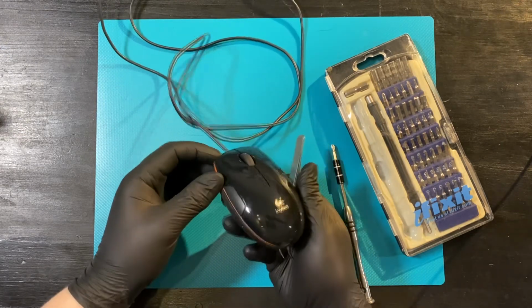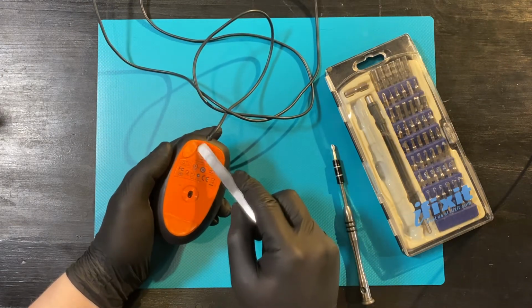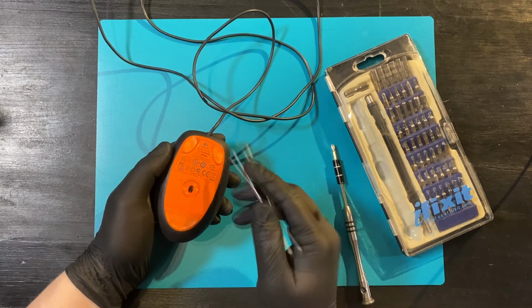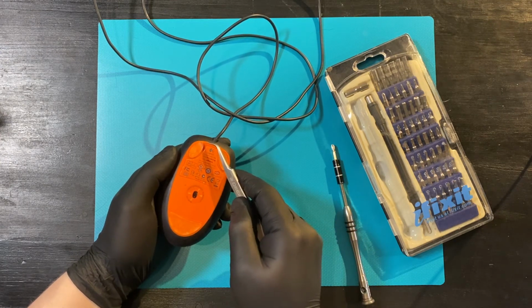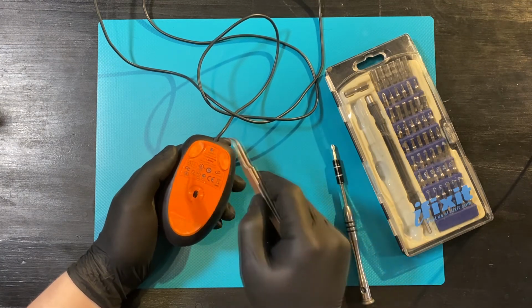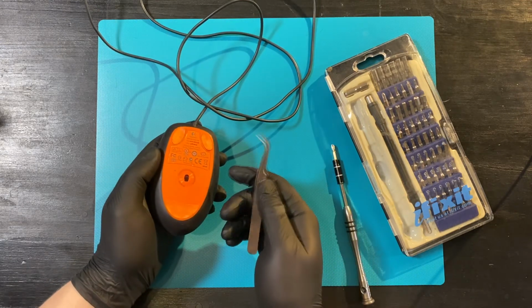And we're done. It's now clean and it can be put back to use. However, these pads down here are not doing too well, even though they were heated up for the removal. So this is exactly the reason why you want to have new pads ready for the replacement. Because they will just snap in without any problem. These will probably come off at some point. But that's future's problem.